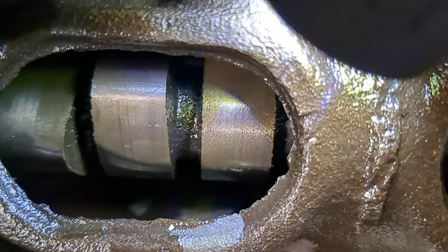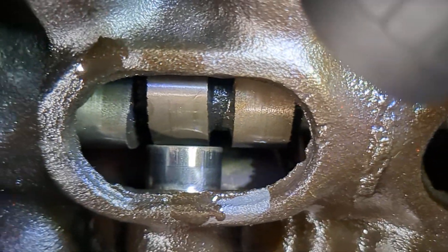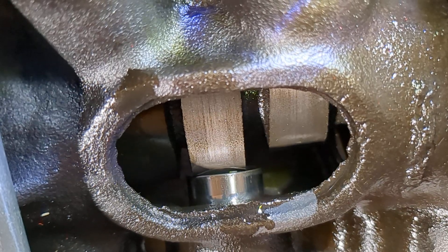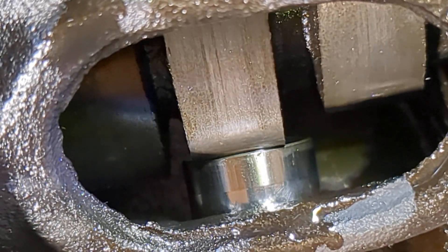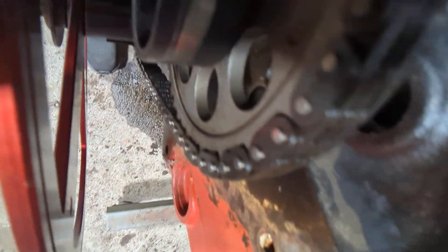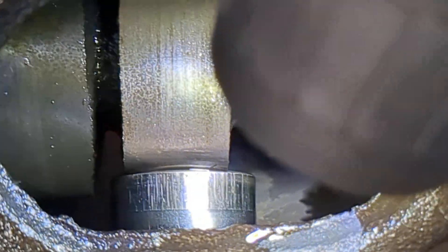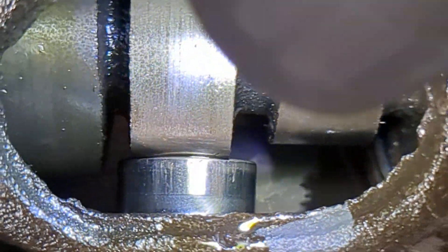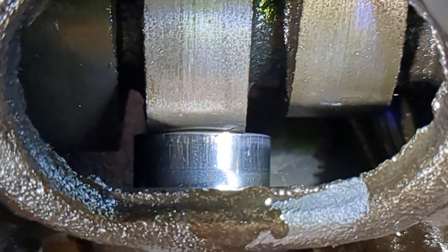To show what I demonstrated — if you put this 904 lifter in the hole, okay, it's in the hole. You can see the angle. Everybody see that? Get a good look at it. This is tied to the crank by a timing chain. That lifter right there will give you the correct lift, the correct duration — or will give you whatever the cam is, whatever the cam lift and duration is. That lifter will rise and do everything it's supposed to do so that you can see what that cam lobe spec is.